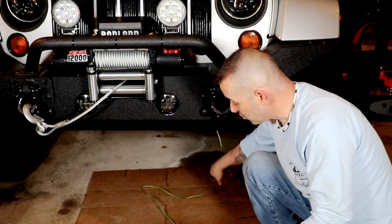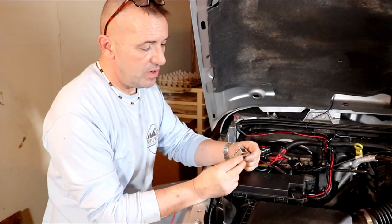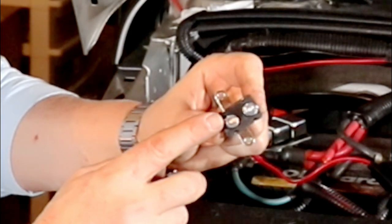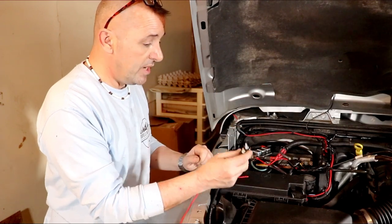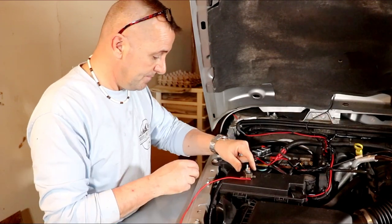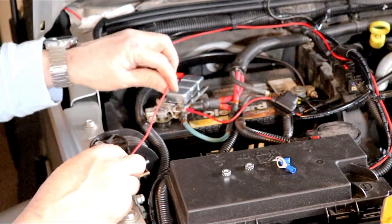I'm going to start running this red wire up through the engine bay towards the battery. I've run this red lead down behind the radiator, and here is the 15-amp thermal fuse. There's a copper post and a silver post. The copper post always goes between the wire and the source battery — so this wire going from the RV six-pin connector goes to the copper post. The silver post wire will go to the positive of your towed battery.